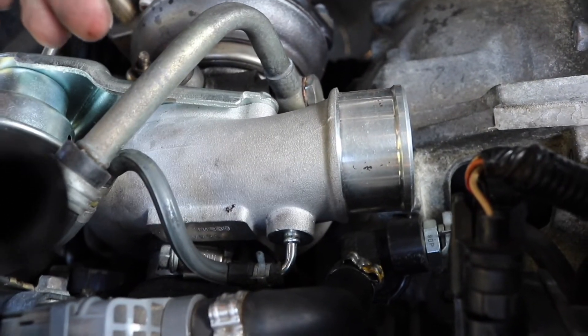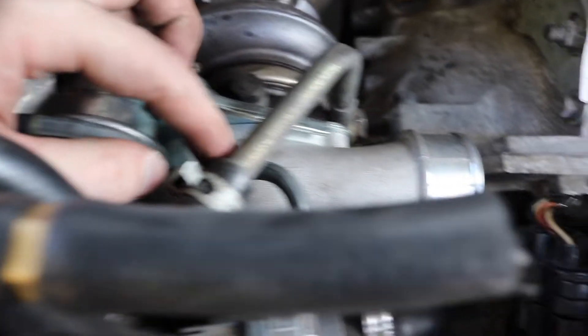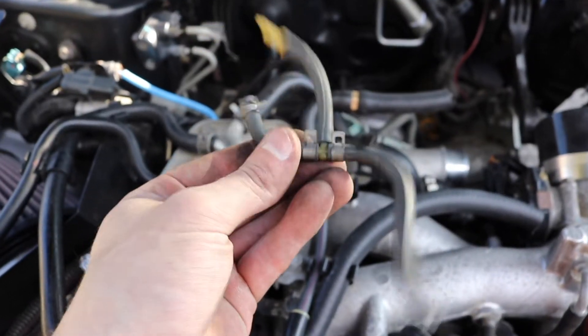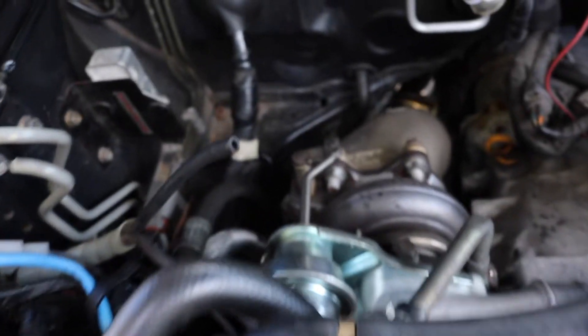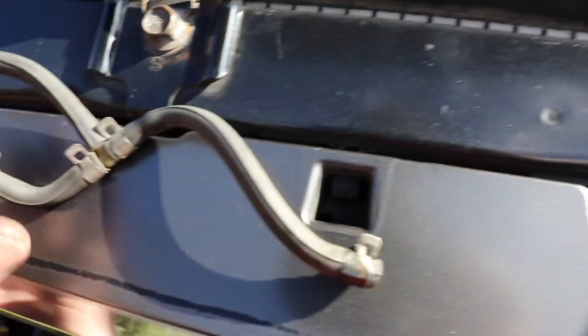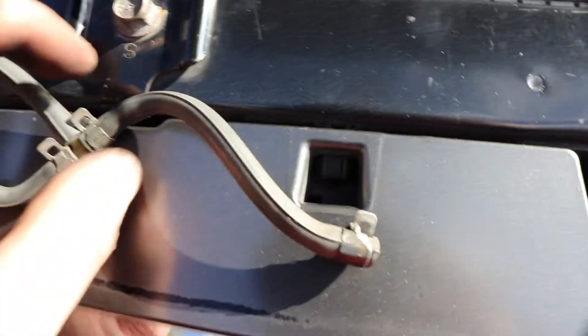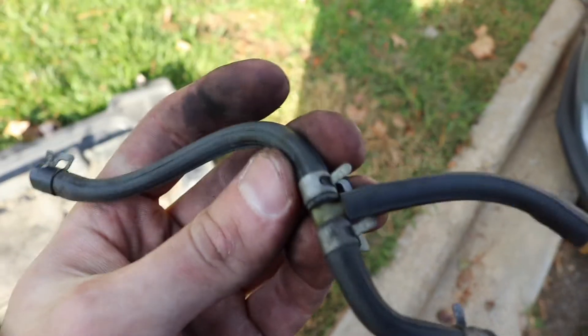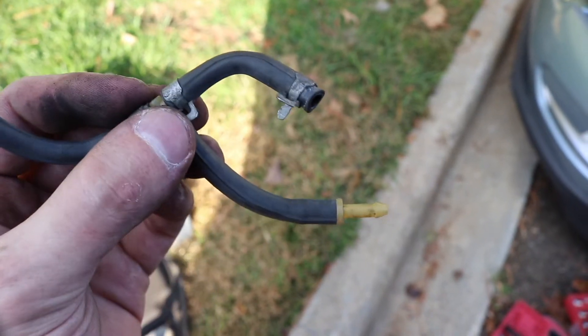It's very simple to take this off — just take the hose clamps off this line. If you're replacing it rather than boring it out, take the whole Y-piece out and order a replacement online. Here's the whole piece: there's the T fitting in the middle, the short piece goes here, the long piece goes on the right side. On newer ones there'll be a dot indicating where the restrictor is, but on mine I can see a bulge way up here — that's where it should be.